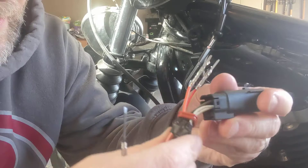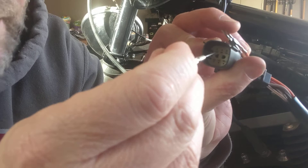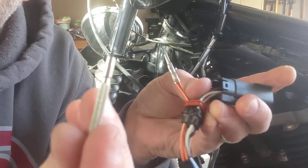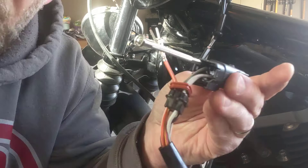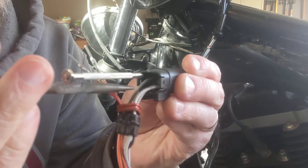And then here's one more thing. There are little indentions along here that need to be released. If you see where that clip is, there's a little tiny hole up there — that's the top. So when you turn it around, you're going to stick your small screwdriver inside the top of that wire — just like that. You're releasing it as we speak. And then you just grab those needle nose pliers and take out that cord. Ba-da-boom, ba-da-bing.